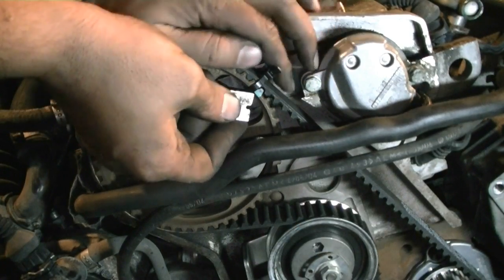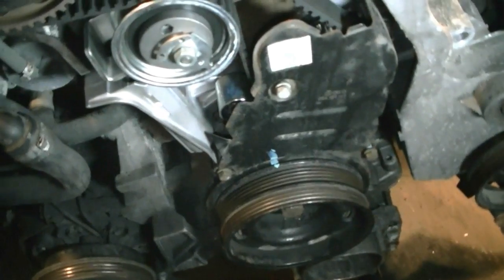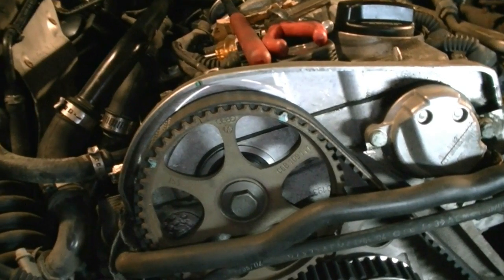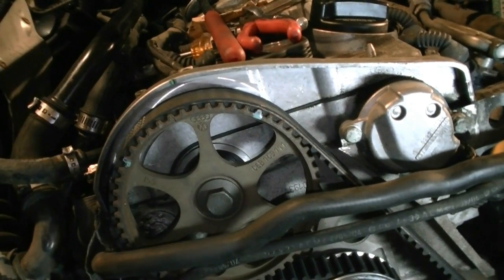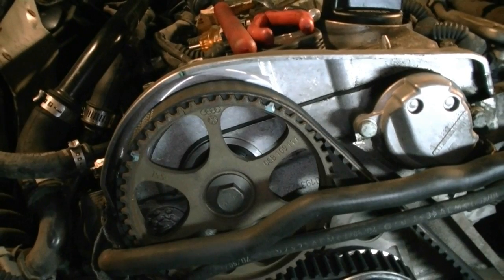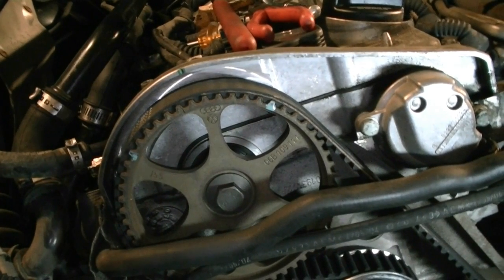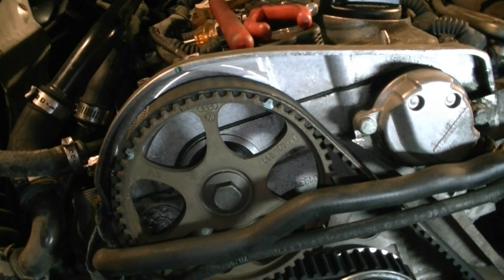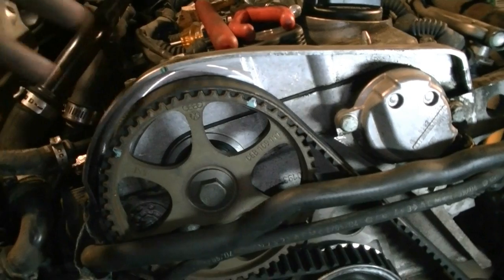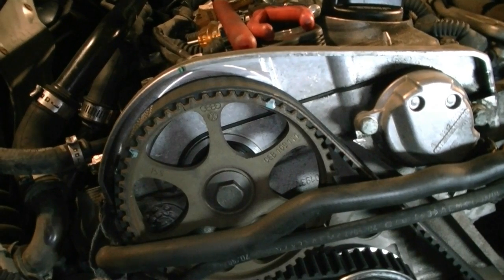Before we start turning our crankshaft, we want to make sure we cut the zip ties. We've got our harmonic balancer back on and we line up the mark we made earlier. Now we double-check it with the camshaft mark, and we can tell it's about a half a tooth off. I'm not going to worry about this too much — I've done timing belts on a lot of different cars, and sometimes they come off by half a tooth when you go to line them back up, but it's usually not a problem. If it's off by clearly more than one tooth, then you've done something wrong. If it's just half a tooth, you should be okay.